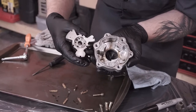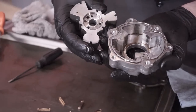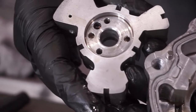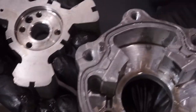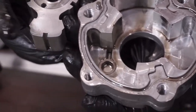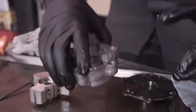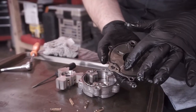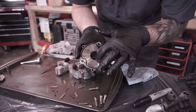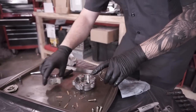And if you look closely, you can see that there is actually a little bit of debris that's made its way in here. It's not as bad as some of the AVCS pulleys that I've seen. Some of them in images on how-tos online are a lot worse. You're seeing bigger chunks, but there is actually debris that you can wipe off with your finger here. So glad that we're taking this thing apart to do some cleaning to it. You can see more junk in here. See, it shouldn't have this. That should be clean. All right, next step is scrubbing it.